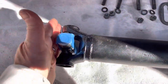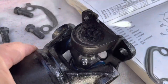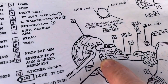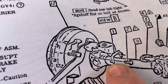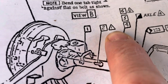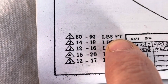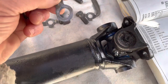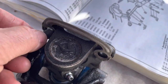That side goes up here. On the other side — which hooks up to the wheel on the trailing arm side — you get this lock piece and a bolt. The bolt gets torque spec number 1, which is 60 to 90 foot-pounds. They use these locks — somebody said they're called French locks — and they go over this part, then the bolts go in.